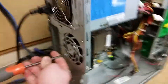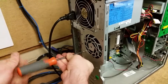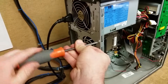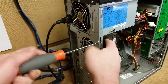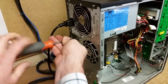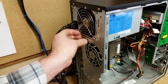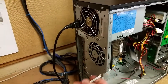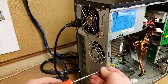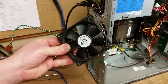Come around back here and loosen the four screws. To do this you'll use a Phillips head screwdriver. Hold on to your screws just in case you need them to reinstall the fan — a lot of times new fans will come with screws, but hold on to them just in case.